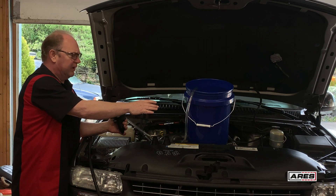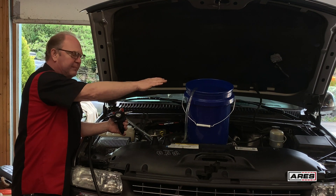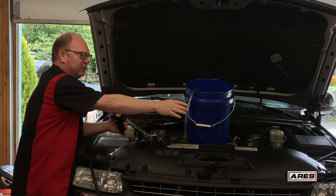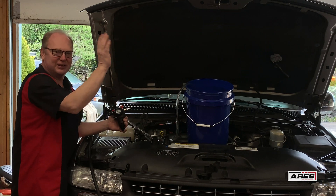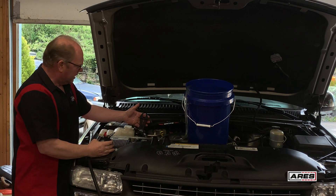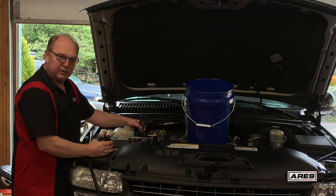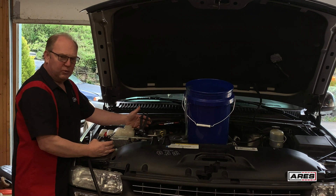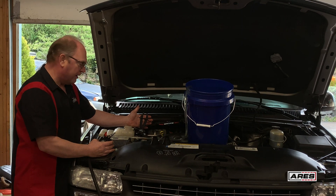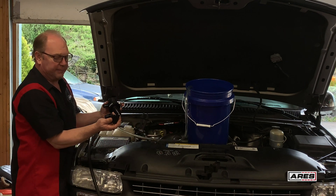Then you have your valve in the back that controls your fill bottle or container. I've got it all in a bucket here, and I've got the bucket up high — that's kind of important, get that bucket up as high as you can. Sometimes you have to weight the end of the hose to keep it down inside the bucket. On surge tanks, sometimes you've got to pinch off the extra hose. We have a set of pinch clamps, the 71160, a set of three that'll really help you out.